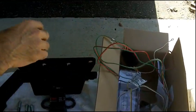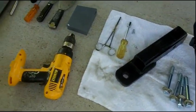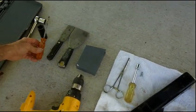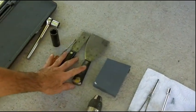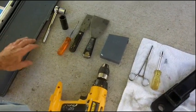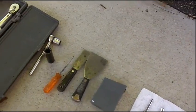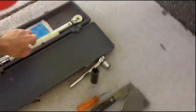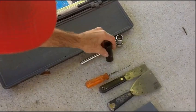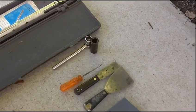We're hoping it's really easy — we've heard it's not so hard. The tools I need for the hitch will be a screwdriver and maybe a putty knife to remove the plastic retainers. And then I'll need a torque wrench to tighten up the bolts to 75 foot-pounds. A three-quarters of an inch or 19-millimeter socket will work.